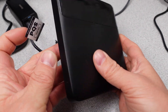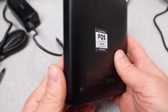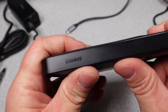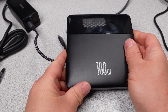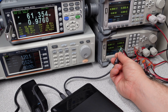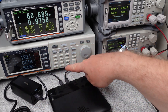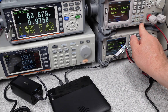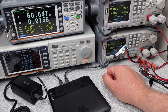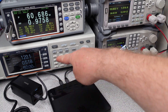This one is tested but not yet on any database — I need to get to that. The power bank has that one fatal flaw of not being able to meet its primary claim — it just doesn't do 100 watts discharging for any reasonable amount of time, and will fail to charge devices that can use that much power. If you don't think you need that much — for example, my laptop uses 65 watts — it will handle charging that until it's fully depleted without any issues. In terms of efficiency, it is near the top. Value-wise, it isn't the best option, but it's not bad if you can find it on sale, which it does frequently. If you want to pick one up, there will be an affiliate link in the description. You could do a trick and plug in a PD trigger to force lower power on the other USB-C port, and then it won't shut down during charging a higher power device, but you'll only get 65 watts on that one port.